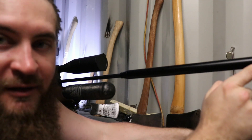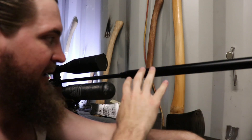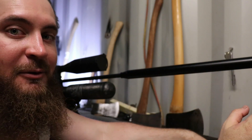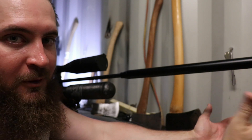And that is not something that you want to be shooting with. If you clip the end of this thing with a pellet flying down the end of that barrel, it's all bad — it's not going to be good. And an empty tube with no baffles in it does nothing at all for sound reduction, so there's no point in trying it at all. It's dangerous and it won't work.